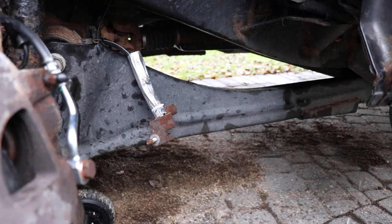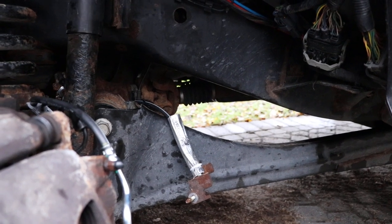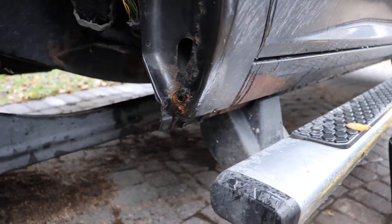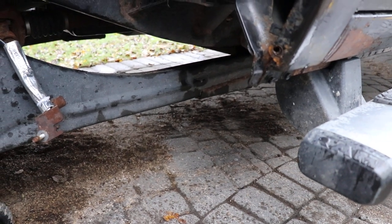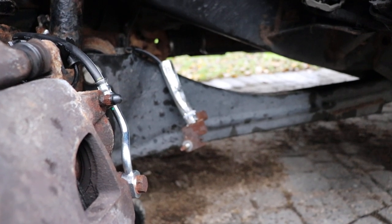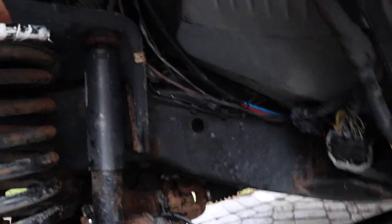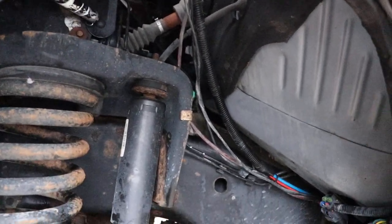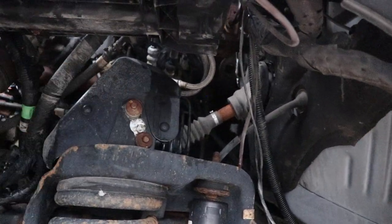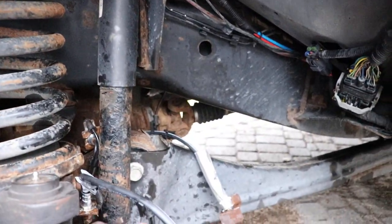I haven't seen any videos about this dual-hose setup. I'd like to get stainless braided lines for all of it — I figure there'd be four up front, maybe two for the axle, and two for the rear calipers. There are quite a few hoses on here and as these vehicles get older and the lines bind up, it's going to be a problem. At least that line is easy — you can replace it with a copper-nickel line. But the one going up to what I assume is the ABS or distribution block is going to be bad on older trucks. Anyway, glad I could show you that. Thanks for watching.